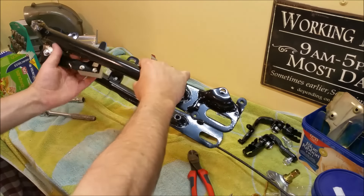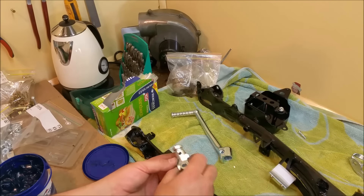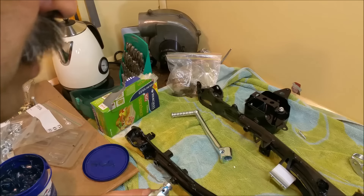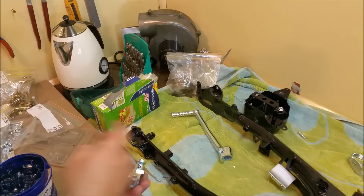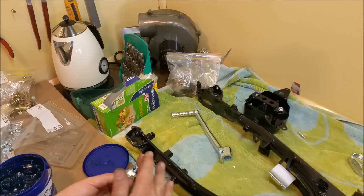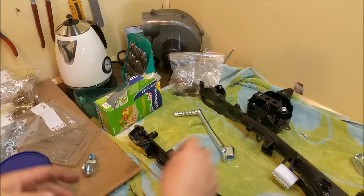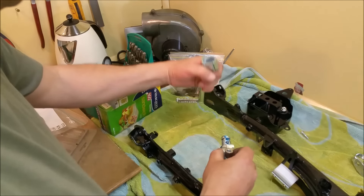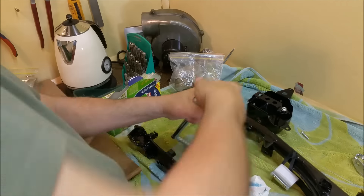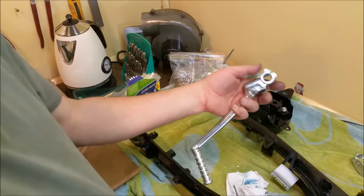And there we go — that's the first bit of our bike assembled, which is cool. So I've got these bits and pieces here. I'm going to stick them in that hole — pop a little bit of grease in there, followed by a spring, and there's a ball bearing that sits on top, which gives the kickstarter some detent. I'll just do that, sort of hold it in. I need a rag. So what we've got to do is feed this into here and it will rest in that hole. This is pushing in. Okay, that's nice and positive.